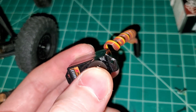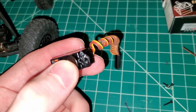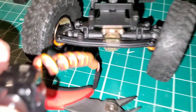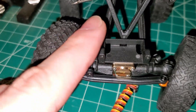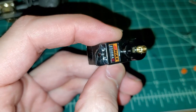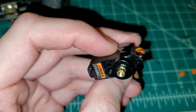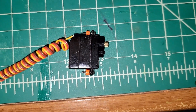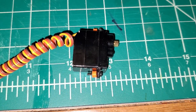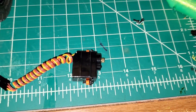Now I should have plenty of range of motion. I'm going to take some sandpaper and round out the edges. The bottoms will be fine because they're underneath the housing — it's just this top corner that I took out. I used some 800-grit sandpaper, sanded the corners down, made them nice and round so they won't snag. I got the screws and spacers in there and as you can see there's still plenty of thread to catch — about as much as these probably had originally. So we're going to drop it up into the axle now.